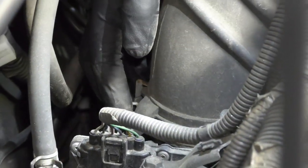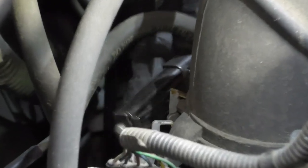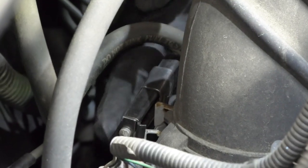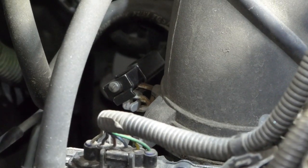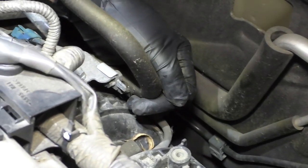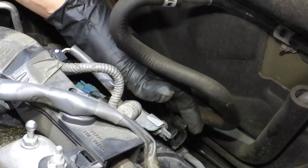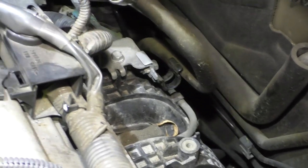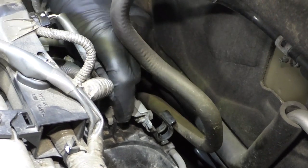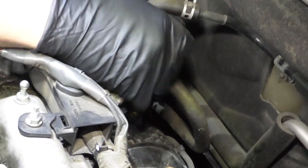There we go. I want to loosen up this hose clamp right here — I'm going to use a cable style hose clamp plier, slide it over the hose clamp and loosen that up. Try to grab the snorkel, just rotate it and pull it off. There's a vacuum line right here that goes all the way over to the brake booster. Slide that out of the bracket, and there's a 10 millimeter bolt right here. I'm going to use a 10 millimeter socket, extension, and ratchet to take this bracket off and just move it out of the way.